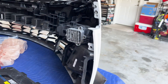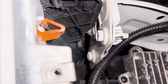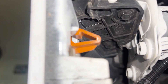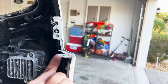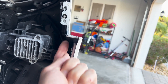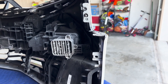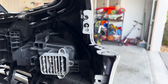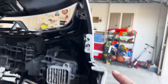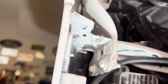Once you get access into both sides of the bumper, there's a bracket behind the panel - push back and you've got three: one, two, and three. It's a black bracket that goes here and it's going to have three 7mm screws. Use an electric ratchet with an extension and a 7mm socket - you'll be able to get all three out pretty simply. Once you get those three, look further up and you have one, two, three, and four more screws at the top of the bumper.